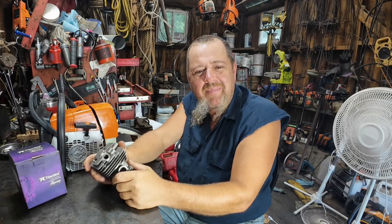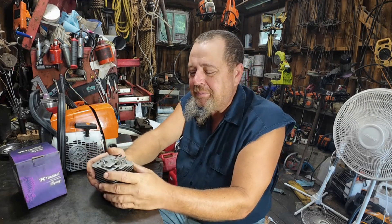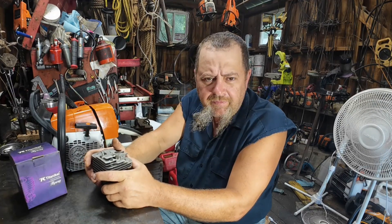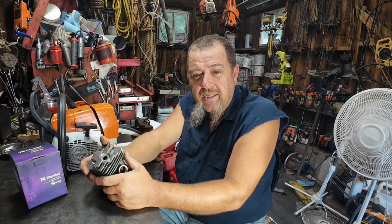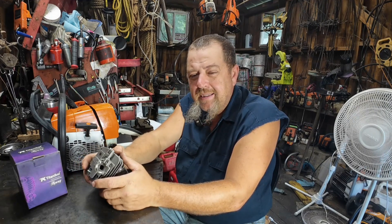If you enjoy this kind of thing, give me the old thumbs up. You know what helps my channel and what doesn't. Ryan sent me this and two more, so I almost feel beholden to him — but I feel beholden to you guys. In all self-honesty, this cylinder did not do as well right out of the box as the Farmer Tech cylinder. I think there are some reasons for that — I think break-in is going to be a huge one. The compression is way down there. That thing breaks in and gets up where the other cylinders are at, I think we'll be in good shape — and I'm not making excuses.